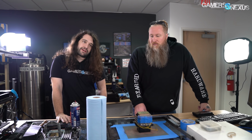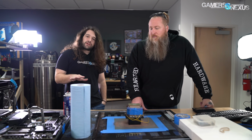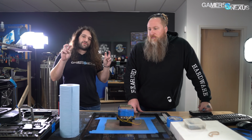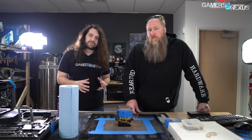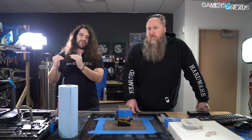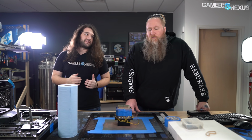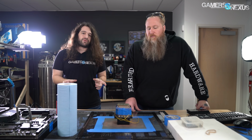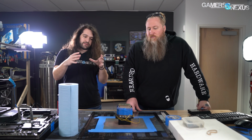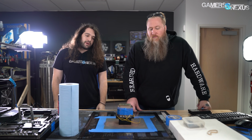So when we did the 9980XE and some of the other chips, it'll vary, but sometimes you'll see a big core-to-core delta change. A lot of people who say there's no difference have no idea how to test a processor for thermals to begin with. They're just looking at the CPU temperature number in the maximum column in HWiNFO after running it for maybe a few minutes. What you really need to do is look at core-to-core deltas, because that will improve as you reduce the height delta from the different spots on the IHS. So there is an improvement.